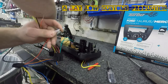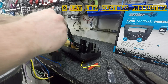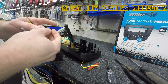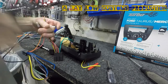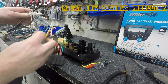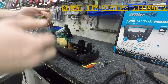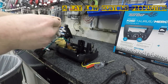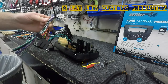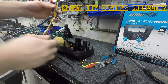Use some crimp caps. Do not use wiring nuts, duct tape, scotch tape, or anything like that — those are flammable and will catch on fire, and you don't need a fire in your dash. You can use electrical tape if you're at home and don't have crimp caps, but nothing else. Once they're all crimped up, take a zip tie and wrap it around all the wires, pull it as hard as you can so it looks like a teepee, then cut it nice and tight. Your wiring is complete.